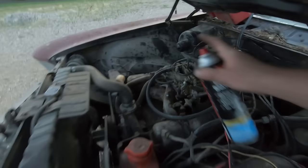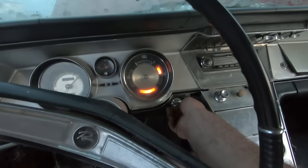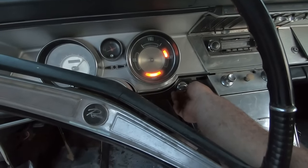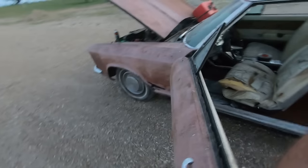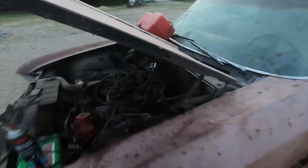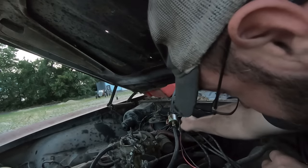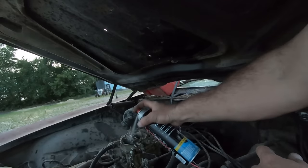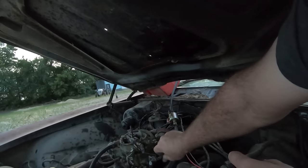All right, let's get some brake cleaner. Take that. Oh, cripes. We don't have the loser switch hooked up anymore. Let's see if fuel deliveries are an issue. Apparently not. Leave our key switch on. Hook our loser switch back up. See if we lost spark. All kinds of spark. What the French toast? Flooded.